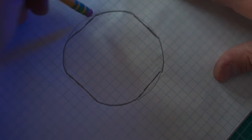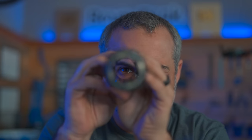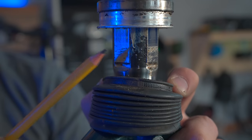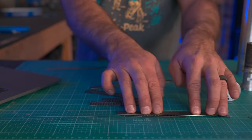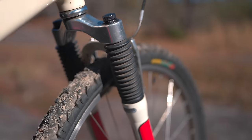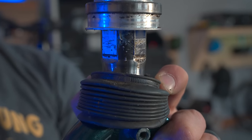I made an attempt at drawing what the head shock's shaft looks like — it's basically a cylinder with four flat sections cut into it. Those flat surfaces are there for two reasons: one, it keeps it from rotating, which is important because you're steering with this thing. But also, it's a surface that needle bearings roll on. So instead of having two stanchions plunging into wiper seals and bushings, this is basically rolling up and down. It's said to be frictionless — that's a little bit misleading, but I think you get the picture.